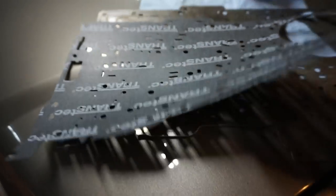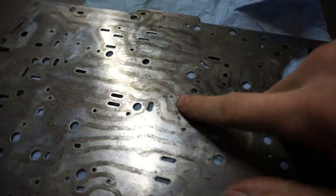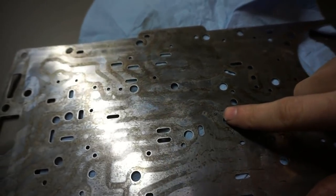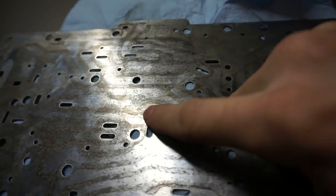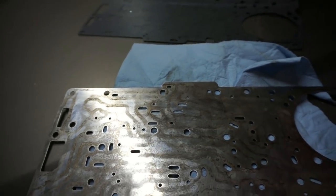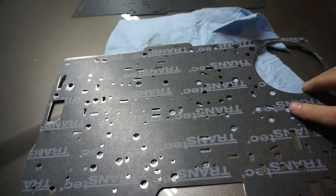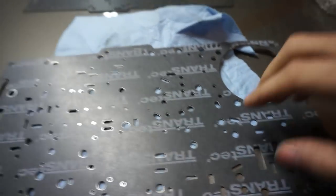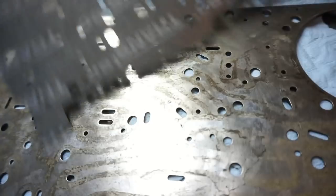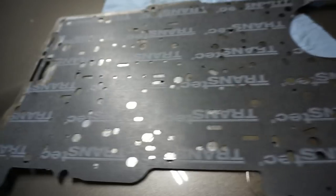So what I want to do is verify that this is the right side. I put this gasket on the right side — you can see there's a little hole there and a couple other ones right there. As you move across we'll find them. I'm going to take this thing, flip it over, and line it up to the big hole so I know it's in the right spot. You can see in this spot, as I move it away, that's right where that little hole is, so I know this is the gasket for this side.